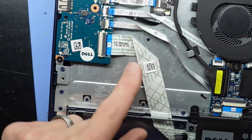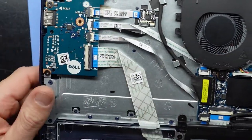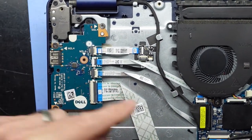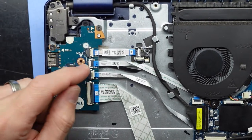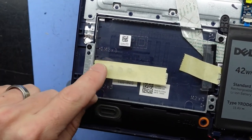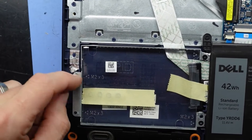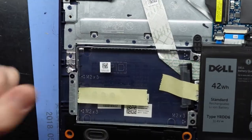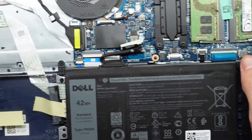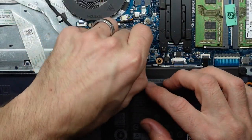I'm not sure what we have here, but it looks very archaic compared to what I normally see in most laptops. We do have the screen connector going up here. And down here we have four screws — there's the hard drive connector, so the bracket comes out and you can put your drive in from there. From here I'm going to reconnect the battery and hopefully be able to get this to power on and actually detect the hard drive.